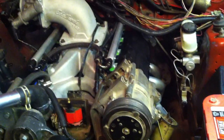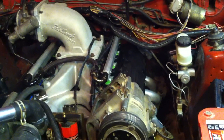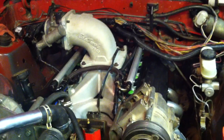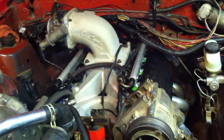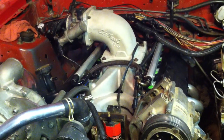The other thing is the spacers between the sway bar. If you want to keep your front sway bar, you need to space it down, otherwise you will hit the front of the oil pan with your sway bar when you drop it. I read a lot about it and tried it slowly to check clearance — I ended up having to space it down about an inch and a quarter all said and done. Then I could keep my sway bar, which I was happy about since I drive more on the street than the track.